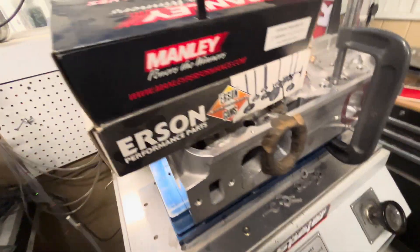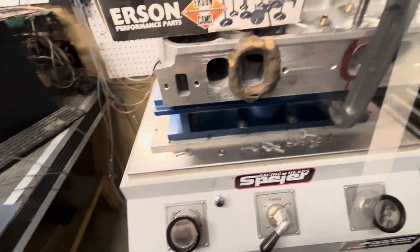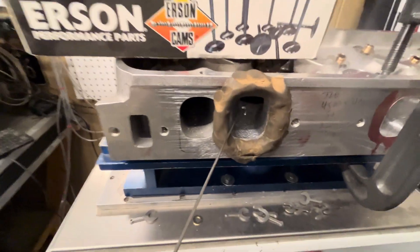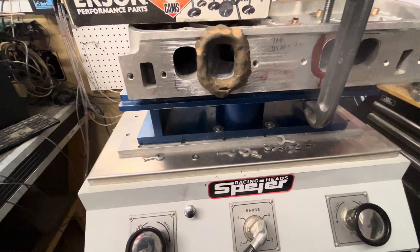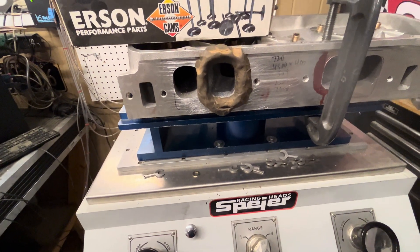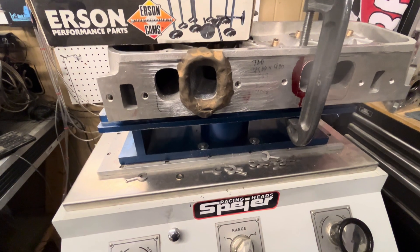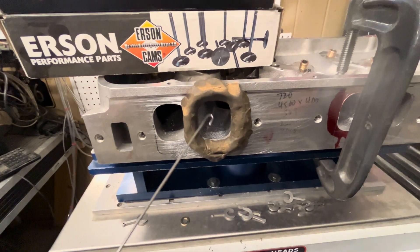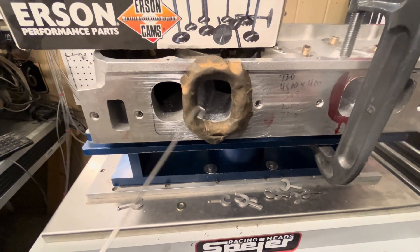Other people may look for something different in their ports, but I'm going to put my pitot tube basically right here from the start and push it all the way back in the center of the port. Two key things: one, you want the velocity numbers tight, and two, it's telling you your cross sections. Basically what it's going to tell you is if you're big, small, big — ideally you want the throat the minimum.